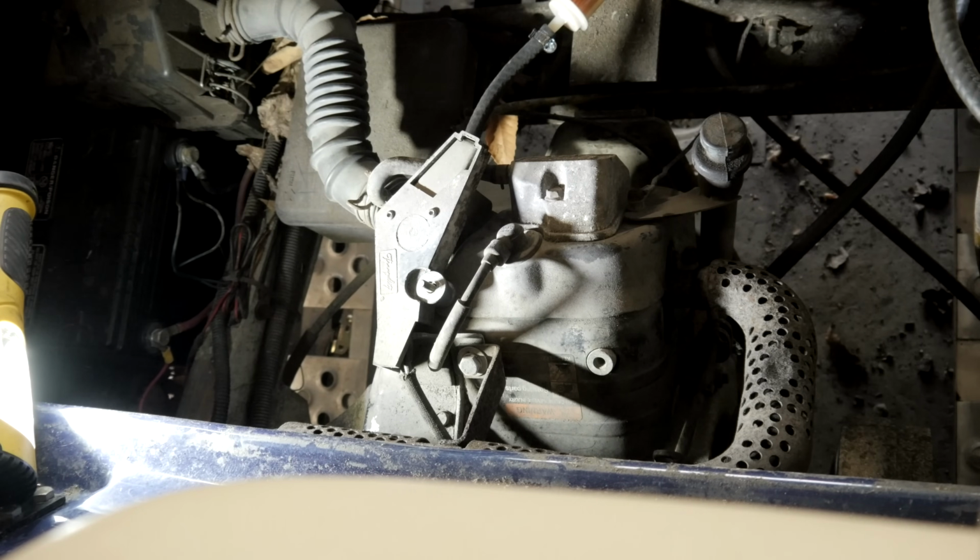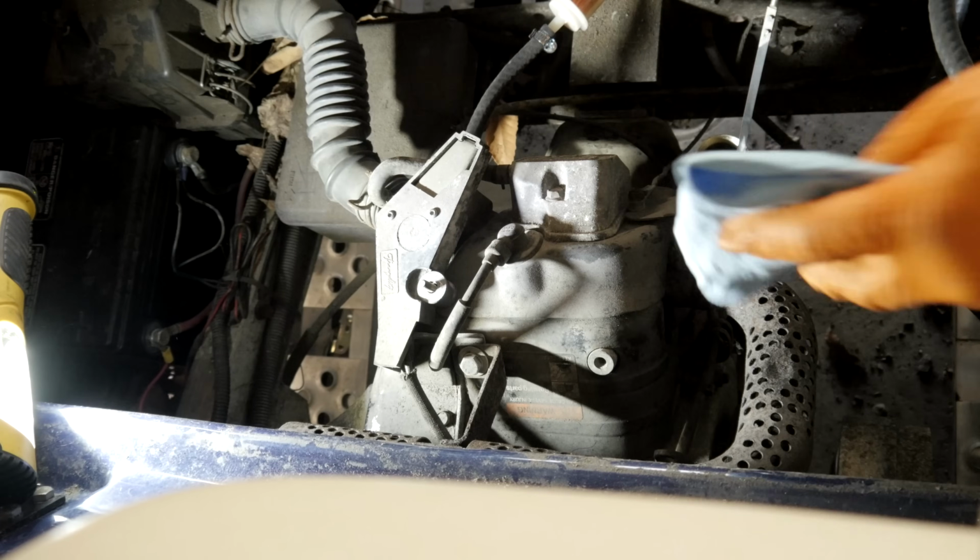I think that's a success. I added 2 ounces of stabilizer fluid, Stabil fuel stabilizer, to the tank. That will kind of help with any gnarliness in the fuel system. It'll kind of keep the gas okay until they start using it up. So basically this cart is done.